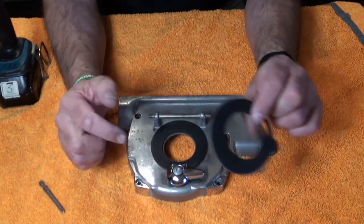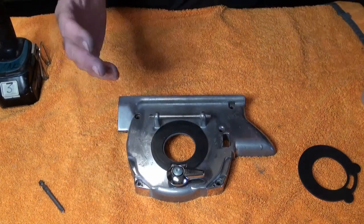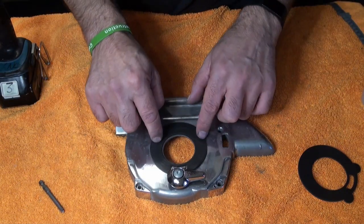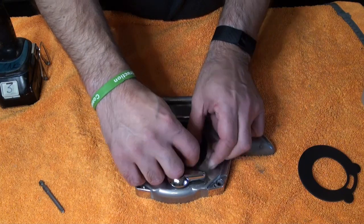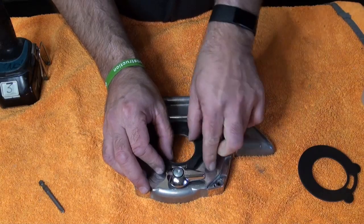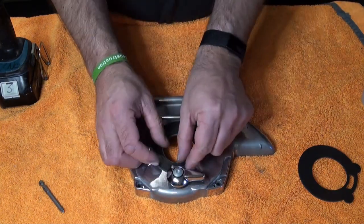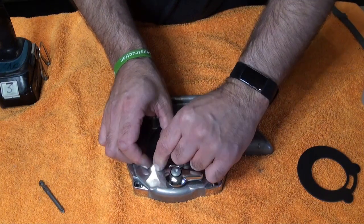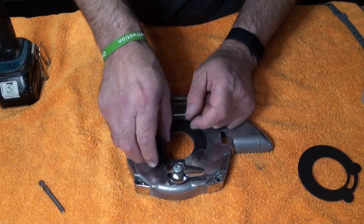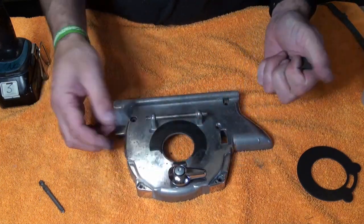So this is the new seal here. We're just going to peel the old one off, and then what we'll do is clean it with some isopropyl alcohol and just get all that gum and grime off there. To remove it, you literally peel it. You can heat it up with a hairdryer if you want - it just depends how long that seal has been on there. This one has been soaking in warm water because I've had it apart, so it's coming off really relatively easy.